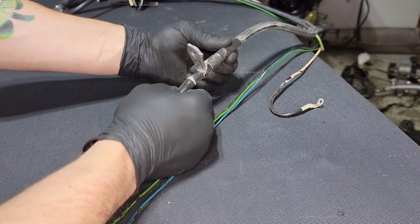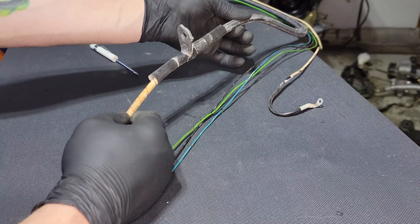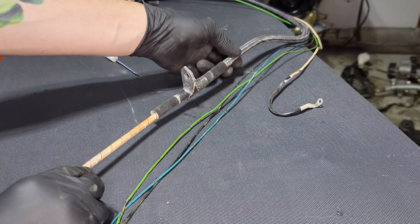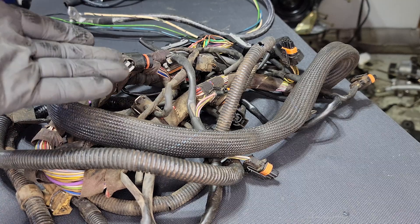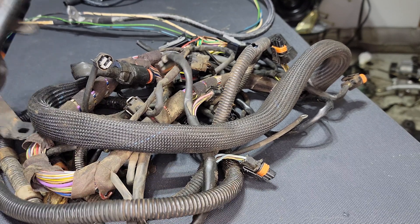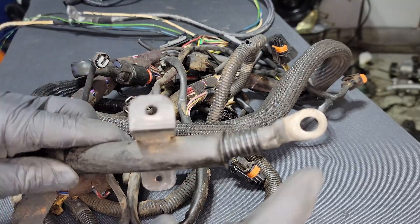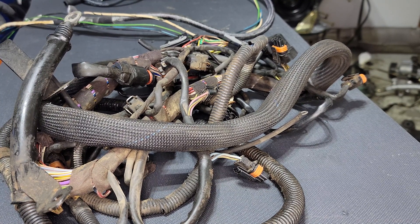I think I'm going to leave these bits of sheathing right there because this is the only cable in there — it goes from the starter to the other end of the harness right here. You only got four wires to go down this thing, so let's get to replacing those. Here is the donor harness — this is the harness out of a 112 engine, the lower engine harness. You can see part of the tube right here that mounts to the bell housing, and then this goes to the starter. I'm not going to use this giant starter cable because the sheathing and insulation on the outside looks okay, so I'm going to leave that as it is.